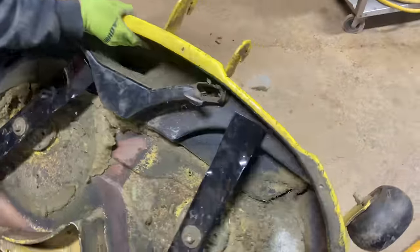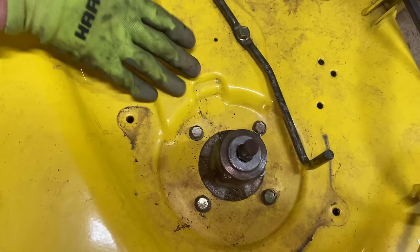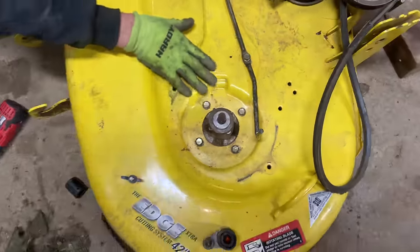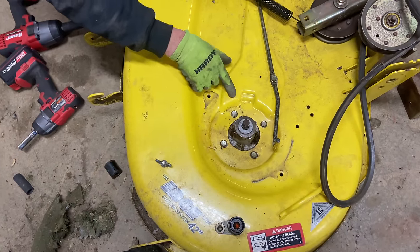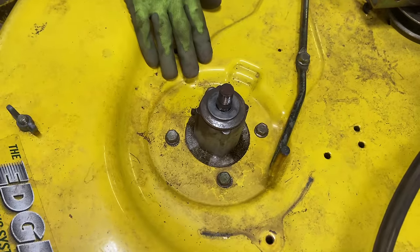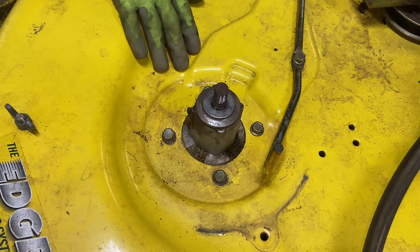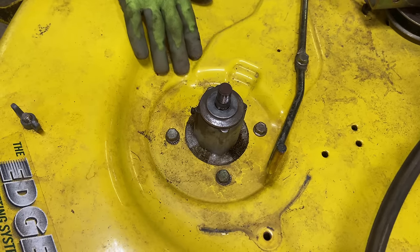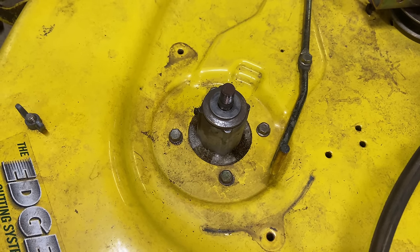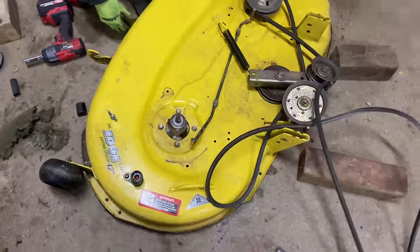Right here is where we had the bend, and we just used that block and the slap hammer and we straightened it all out. I would definitely recommend taking your hub off because we used to try to do this without taking the hubs off and every now and then we'd crack a hub. You don't want to crack these hubs — they're expensive to replace. It's just better that you take the hubs off and straighten it. Sometimes you have to hit them from the other side, but that's pretty much how we straighten the mower decks in my shop as far as getting the blades side to side. If you have any questions or comments, please leave them below. This might seem barbaric, but if you don't want to replace your mower deck, this actually works really well. I hope you enjoyed this video — please give it a thumbs up, subscribe, tell your friends about my channel.